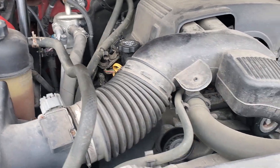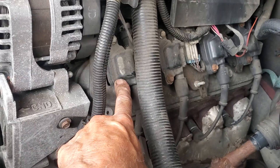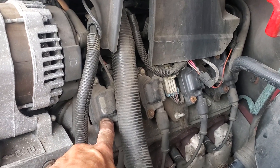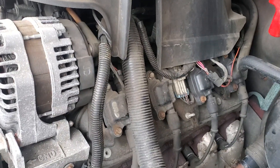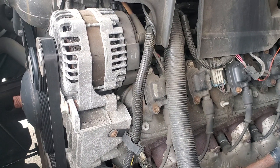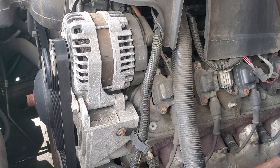I get the boot off, which is connected to a coil pack. A coil right here is the coil pack. There are eight of these, and they range anywhere from $35 to $90, depending on if you get them at an auto parts store — twice that much, of course, if you go through a dealership. I did change out the plugs on this side first, and I'm going to see where the results are going to be. More than likely the coil packs are good, but I'm sure they're due to fail — not in the too distant future.